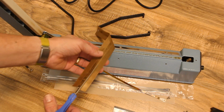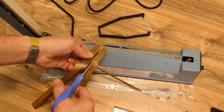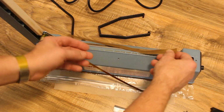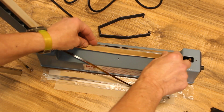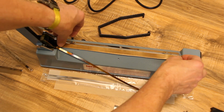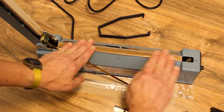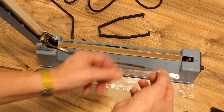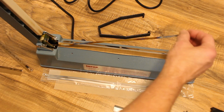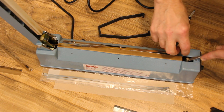I cut off one of the good side pieces of the old top Teflon tape. I carefully lay the new piece in place along the top edge, making sure to cover the bare metal. The old heat strip shows signs of age, but it still works, so I'll reinstall it. I use a screwdriver to push the spring-loaded heat strip connector into place.